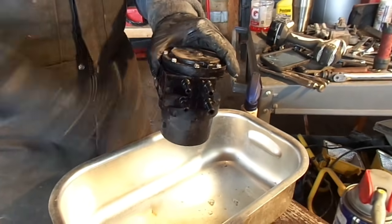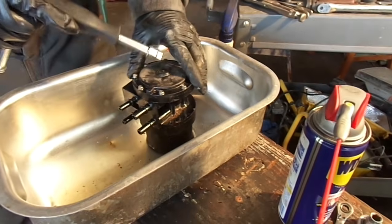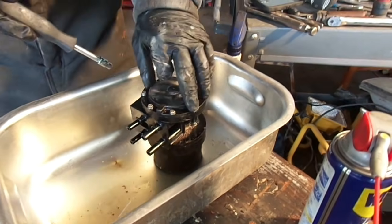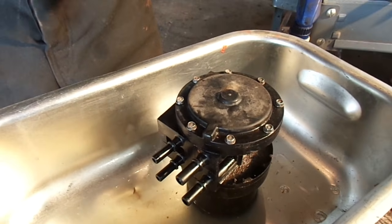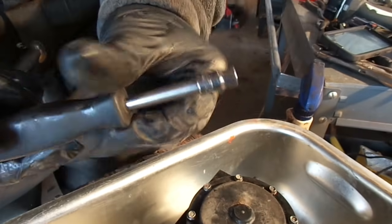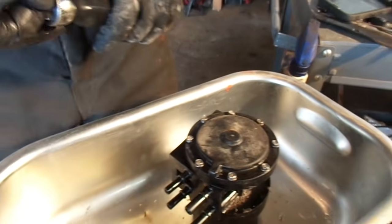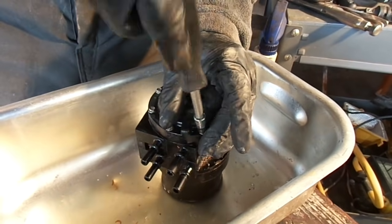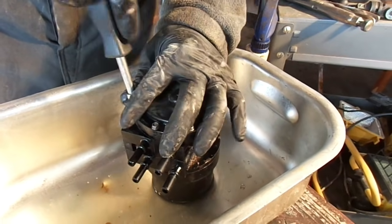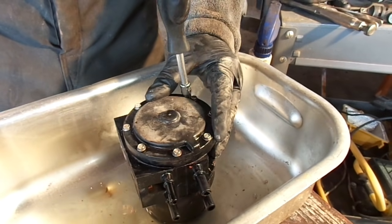The rest of this, there's nowhere to order it. So, your problem is lying up here in this housing. These are small little grabber screws. They're going to come off. You want to use a 1/4 inch. Don't go trying to, when you assemble this, don't go trying to torque down on them like you're putting a tire on. Okay. All you're going to do is you're going to strip them. You're going to cause yourself a bunch of headaches.